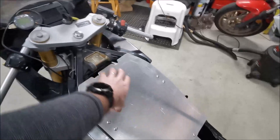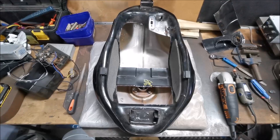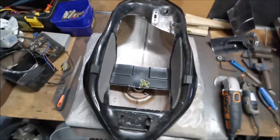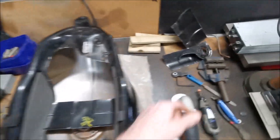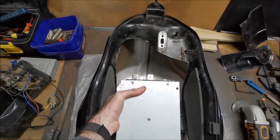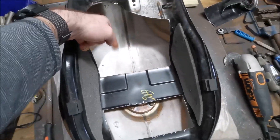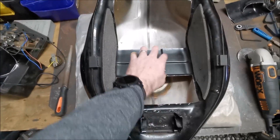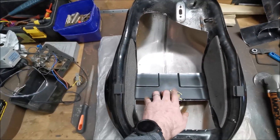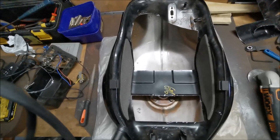The other thing I did today was figure out that with the bigger new motor controller, I was going to have to do some work on the tank. The tank is no longer going to hold any fuel. This motor controller is quite a lot bigger than the other one, and to get it to fit comfortably as well as leave some nice space for all the wires to come out, I had to cut some away at the back and at the front. I've left a little bit for structural rigidity, and also because I need somewhere to mount things like the DC-DC converter on the bike.